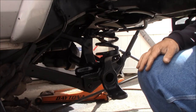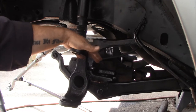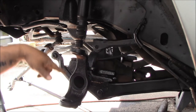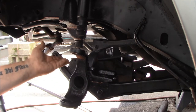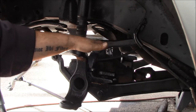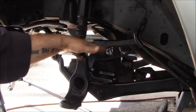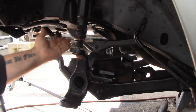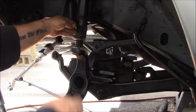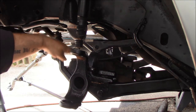Now on the other side I don't nearly have the room because I have a spring in on that side already. I'm going to drag the floor jack around, put it under here, and bring that side up as far as it'll go while keeping this side pushed down. As I jack that side up, this side is going to come down, but it'll reach a point where the spring carries the weight and starts lifting the car up — so it's not making the gap any bigger. I want to get that distance as big as possible.